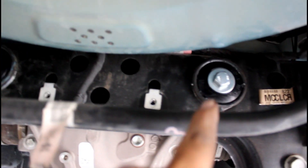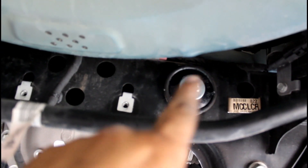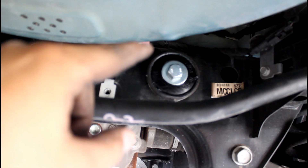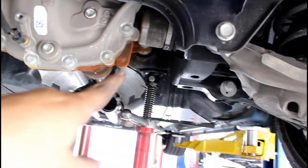Make sure you don't make a mistake like I did. It needs the big washers on the back, not the small one. It's the big washer and the short dowel pin. The short dowel pin goes here. The long dowel pin goes in the front.